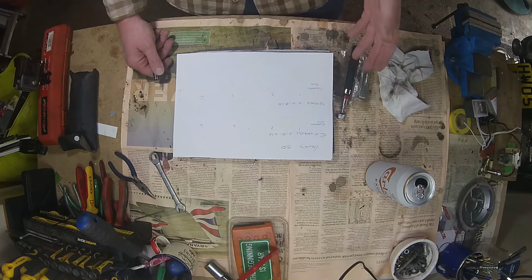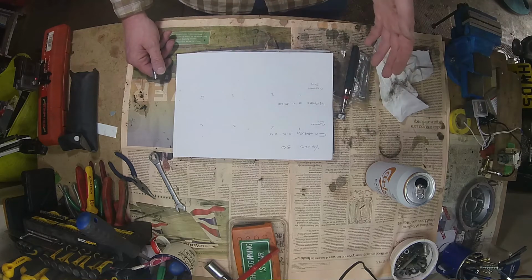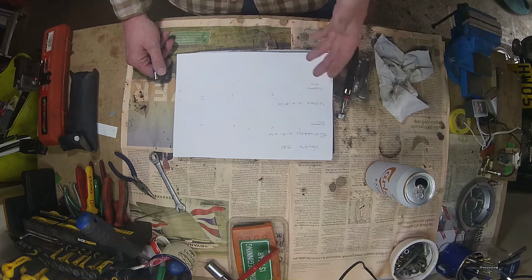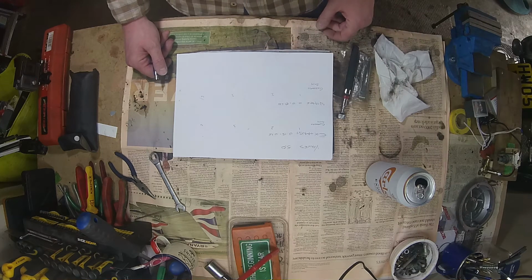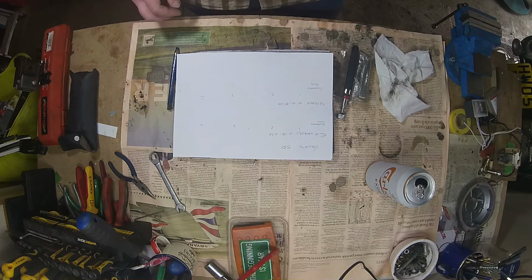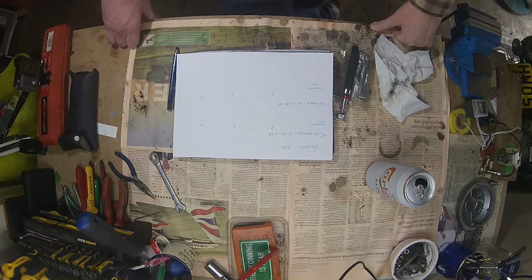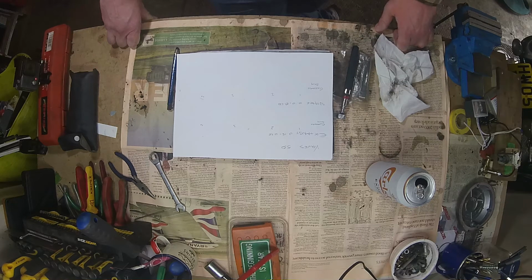Most modern bikes would be 16, so you've got to do all this 16 times. You've got to buy 16 different sets of valve shims, if you're unlucky. Happened to me with a ZZR. I had the valve clearances done when it came to me and every single shim wanted to change. And, well, I think I could have got away with one or two, but once you buy 14 shims, you might as well buy 16 shims. But sometimes you get lucky, you can swap intake side to exhaust side shims, as long as they take you inside your tolerances.